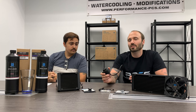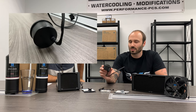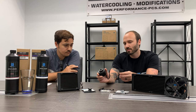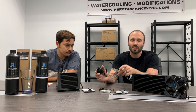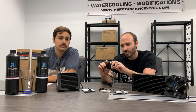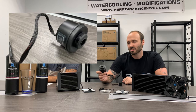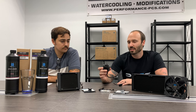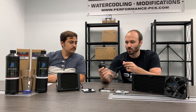If you're looking for a D5 but you don't want to spend quite as much, but you still want a great product, this is a good option. As you can see here, they've changed their power from Molex to SATA for this version. Another thing they've changed is this doesn't come out — it's fixed. It's a ceramic axle. The benefit of that is there's less vibration, and also there's about half the amount of power needed to run it.